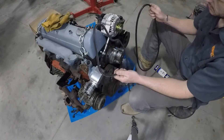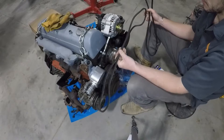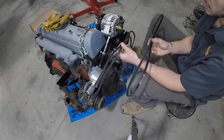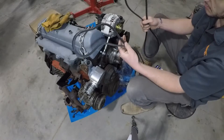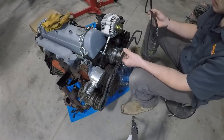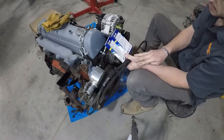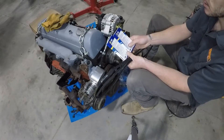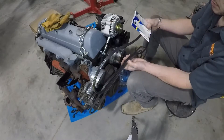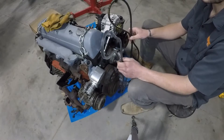Once you get your measurements for both belts, you're not going to be able to get a belt that's the exact length you measured. Since there's more belt on the longer one, if we assume each belt can stretch the same percentage, that percentage equates to a greater length of stretch in the longer belt — because it's longer, there's more belt to stretch. So we want our longer belt to err on the side of shorter. In our example, we have fifty-three and five-eighths for the small belt and sixty-seven for the longer. The shorter belt is the one you grab that's a little bit longer than your measurement; the longer belt should be as close to your measurement as possible.